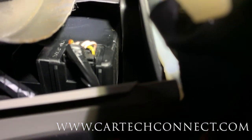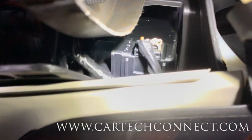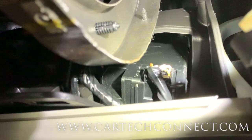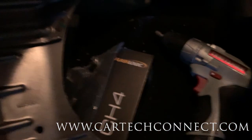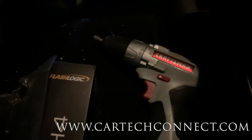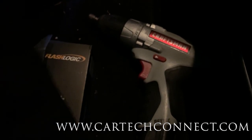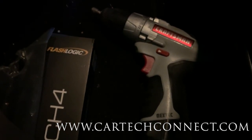There he is, right up there. I'll try to get that unplugged - I believe the release is on the top part of that connector. Yeah, that's the one. Try to reach up there and unplug it and pull it down. Feel around - itty bitty squeeze tab. Kind of squeeze the tab and use the wiring to pull it back at the same time.